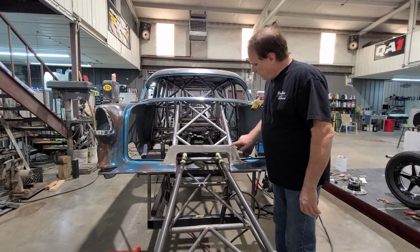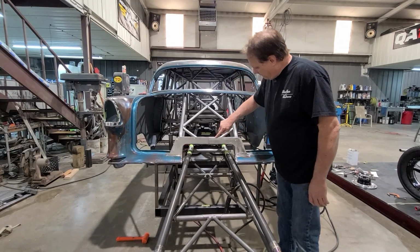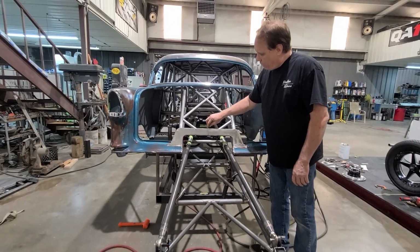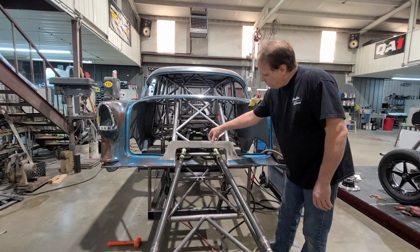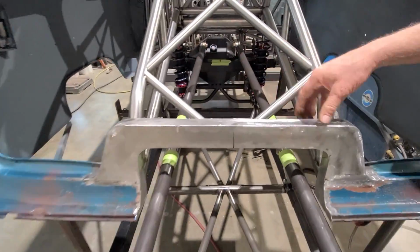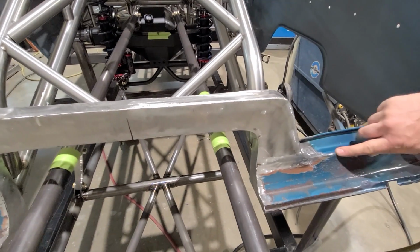and I've got it welded in on both sides, but this is just tacked. This side I've actually welded solid. That's what I'm working on this morning, and I'm burning it in really hard, really hot, so I can come back and put a radius on it. You probably can't see it in the video, but that's rounded versus where it's just tacked as square. I don't want that square. So this radius will mimic this factory radius here.